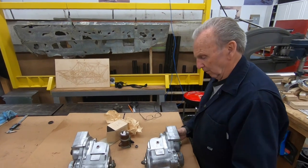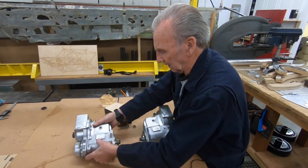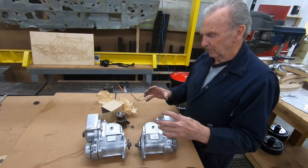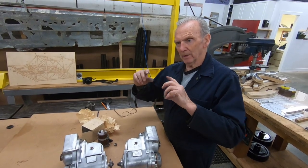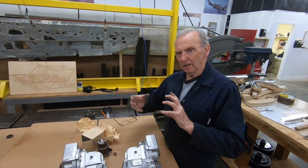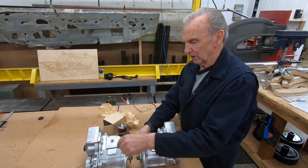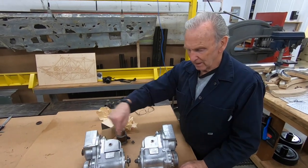This is the right-hand unit and this is the left-hand, and they both run in the same direction. These are the rotor wheels that actually put the spark out — there's the lead and lag. The actual contact points are on the opposite side because they're both turning in the same direction forward. That's why on that side the coil is there and the plug is on this side, and then on this side it's reversed.